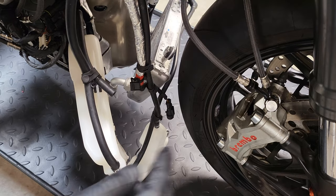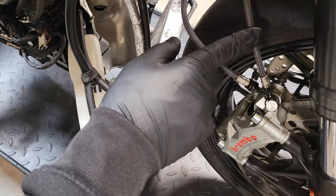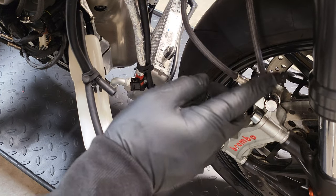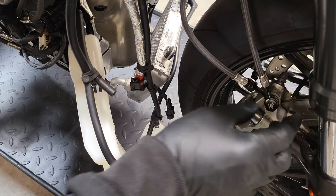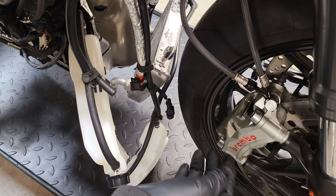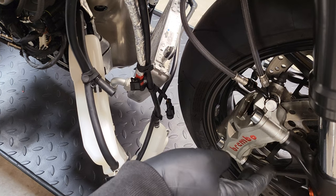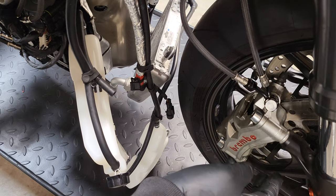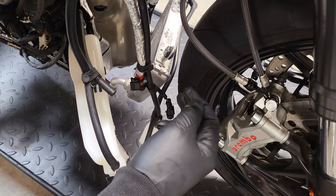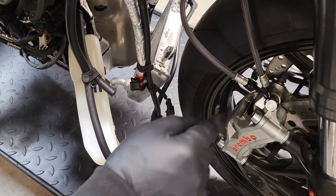Alright guys, welcome back to the channel. Today we're going to be pulling off the front calipers on this Ducati V4. These brake lines were just installed last night — these are the Frentubo carbon fiber brake lines. There's no fluid in the system, though there may be some fluid trapped in the caliper just behind the pistons. The banjo bolt is just hand tight. I plan on pulling the calipers off today — we're going to remove the pads and then pull out the pistons and seals, because I'm replacing those with a brand new Brembo seal kit. You'll need an eight millimeter Allen to break these off.